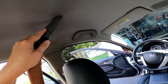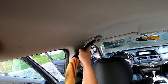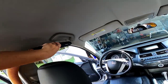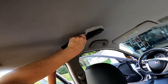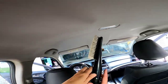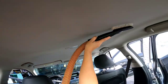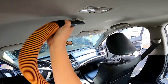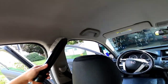First and foremost, when working on a headliner, you can vacuum like this — use a brush attachment if you want to be more gentle. This is doing a decent job of getting off dry soiling and smoke residue, but it's not going to remove it 100%. You can see we've still got heavy staining in tighter areas and corners. We'll try a couple of different techniques for light and heavy staining. You want to remove as much loose soiling as possible before moving to our extraction or bonnet cleaning technique.